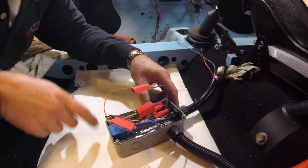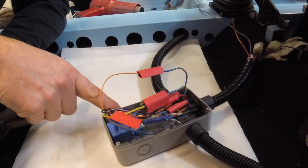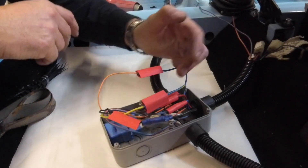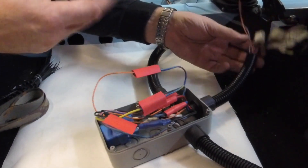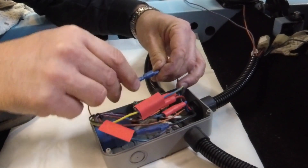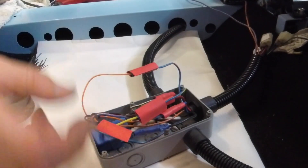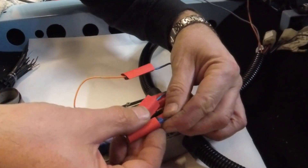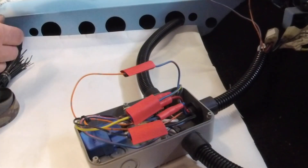This is a junction box — an IP55-rated junction box, an electrical box — it's just handy. I've put the relay in for the heater and then used this area in here, this box, just to extend the cables. So it's just a convenient place if I ever need to break the loom again to change anything. Just in here I've got bullet connectors that just push together, power side being sockets. And then a bit of heat shrink just to hold the bullet connectors together, just to save them slipping apart. I'll just shrink those down and show you how it looks when it's finished.